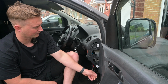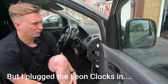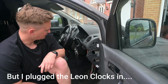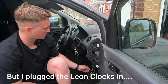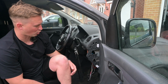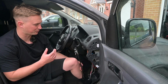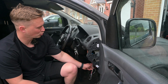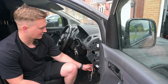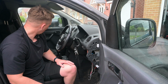Now I'm just trying to think, the brakes didn't come off, so the only other thing is if the ABS pump is maybe not... I don't know, unless it's just because this temporary wiring's in, that's causing the brakes, but the pedal is rock hard. So the pedal's rock hard, as long as we lost the brake pedal, the pressure's there, so it could just be that 5 amp fuse inside there, and I need to get that put into the fuse box. I definitely need to get that done.